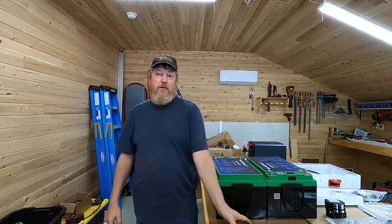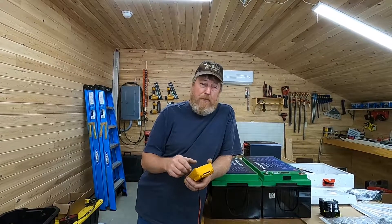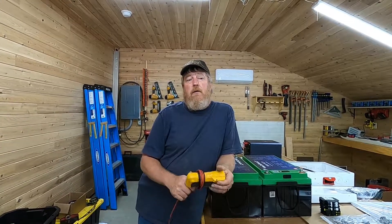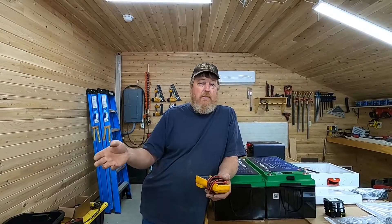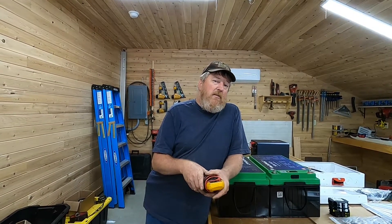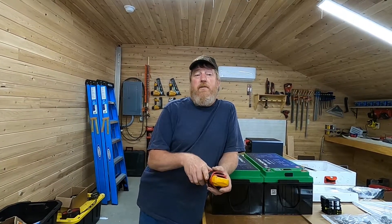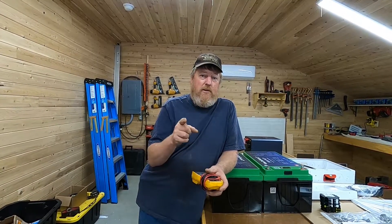Anyway, that's kind of a quick video this morning. I really wanted to show you that golf cart battery, demonstrate voltage measured plastic to plastic, and talk about unbalanced strings and tapping batteries where you shouldn't. It's applicable across the board — you might wonder why we're working on a golf cart, but it's basically a solar system: batteries, a charger, and something to drain the battery. In this case it's a wall charger instead of solar panels, but it's the same idea. Hopefully that was interesting and useful. I'm going to get back to work on this golf cart and figure out what's going on with the radio — we'll bring you back a little later. Thanks for watching, don't forget to like and subscribe.